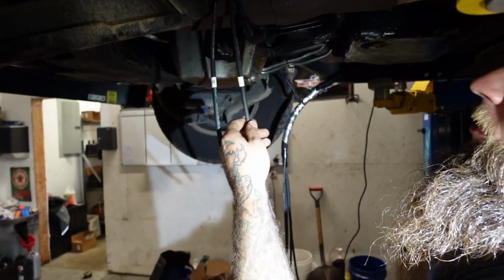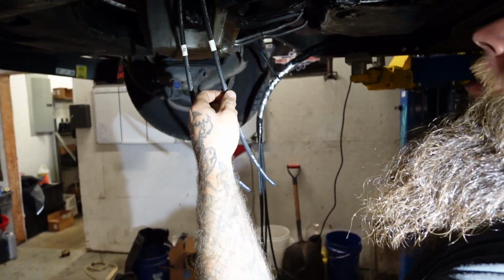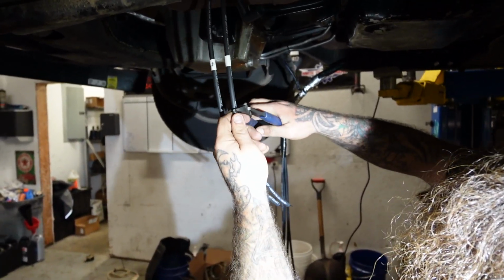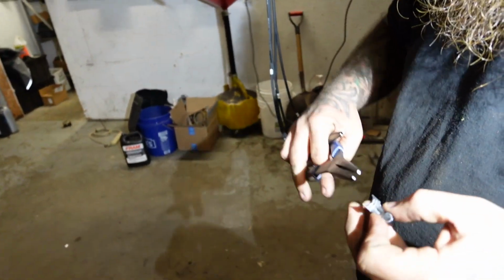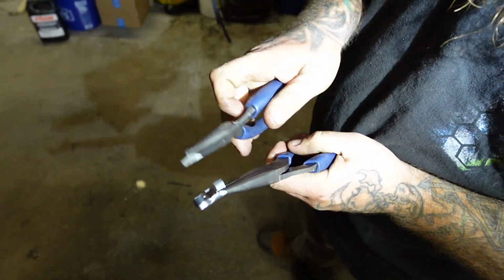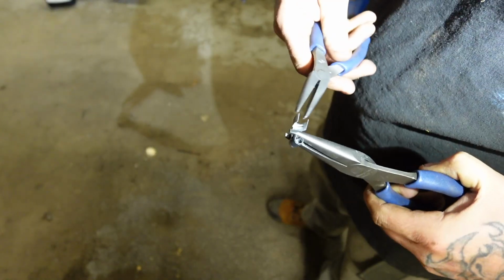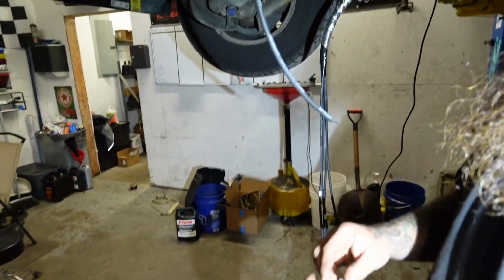Alright, so now we are cutting the plug wires to length and crimping the ends on them and putting the boots on. I've already got number 7 and number 5 done. Just going to follow the line down here to number 3. Found these crimps work best in the crimper if you roll them in a little bit, kind of get them started. Still slide on the wire.